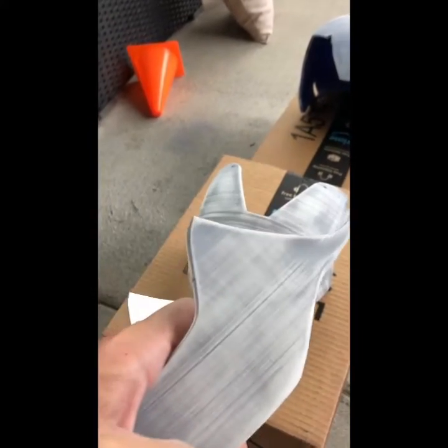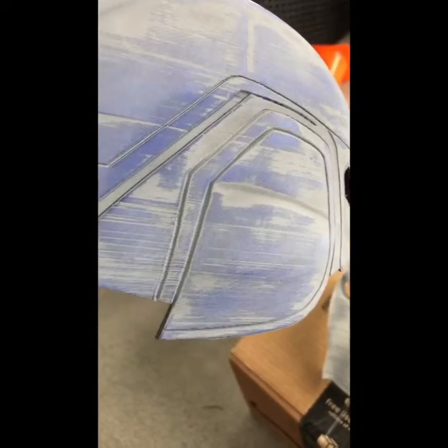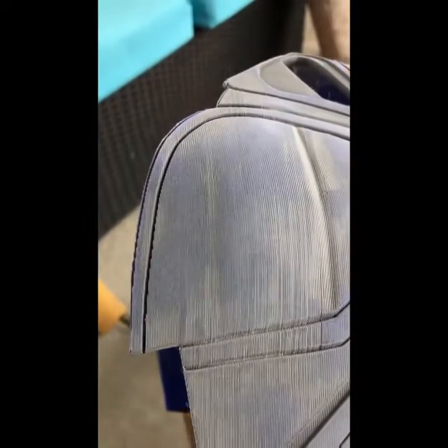There's no lines. Here I will have some worries, so I'm not going to be able to go crazy with the filler primer there, but you can see how much the 100 grit followed by the 180 grit really took off, and that's good. But a lot of this is going to be smooth now when we put the filler primer over.